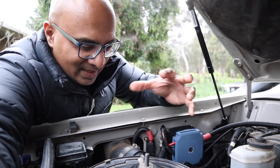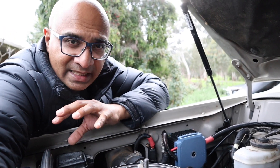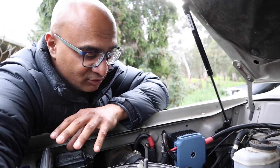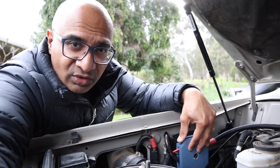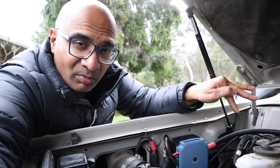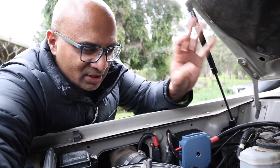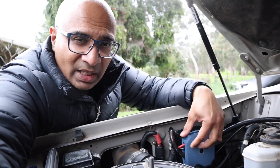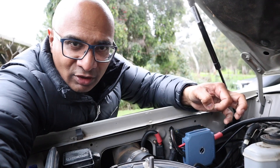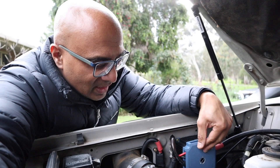What this now does is give my auxiliary battery the amount of charging it needs as a deep cycle battery. Once the battery reaches its optimum, it goes into a maintenance mode and works according to how much draw there is. Rather than just pumping as many amps as it can, this unit actually maintains and regulates the amount of amps being sent into the auxiliary battery to keep it at optimum.